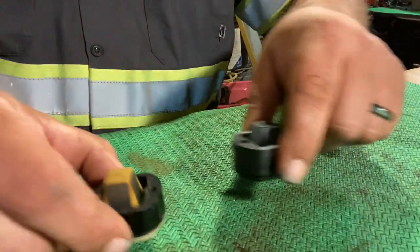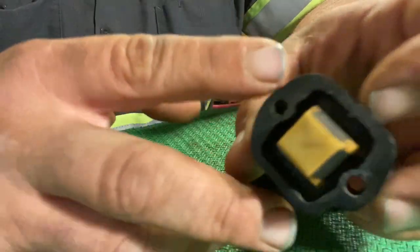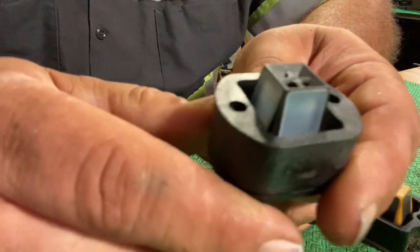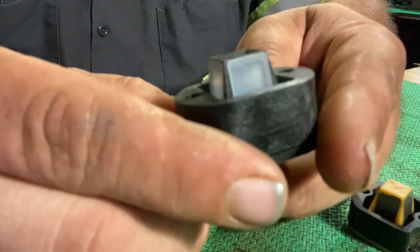This has to do with reeds. I've been trying to figure out a way to replace reeds to a more modern style. I found something that might work — I have not tested it yet. Let me show you what I'm looking at. These are the reeds out of a regular old Homelite Super XL Auto. Now I found this aftermarket reed cage online — this is not made for our saws, but I was wondering if maybe it could be made to work.